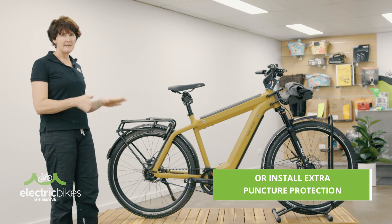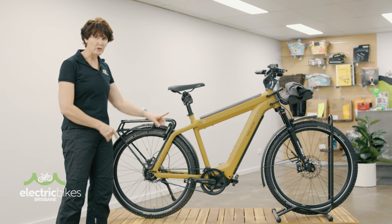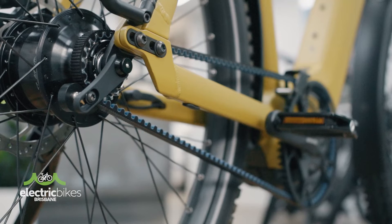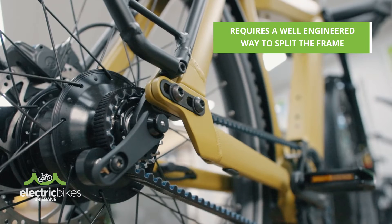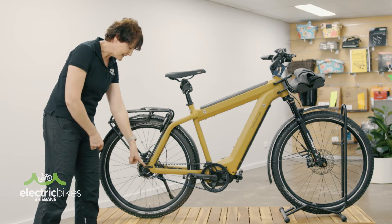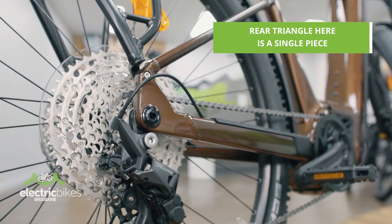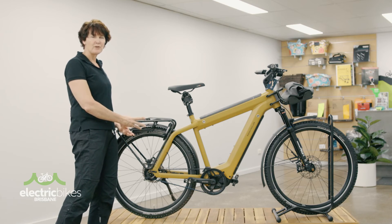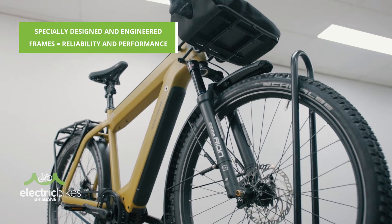What you'll notice — and this is a big difference between a derailleur e-bike and a belt-drive e-bike — is your rear triangles are very different. When you look closely, you'll see on this bike here, the Supercharger, which is running the belt, it's got a split rear triangle. It's actually got sliding dropouts here. So in the case where you do need to change a belt out, you actually have to break or split the frame, and this has been engineered to do that. On a traditional derailleur bike, it's a single piece. But then what you don't see is the engineering and the precision — there's a lot of force going through there. You need a frame that's going to be nice and stiff so you get smooth running of that belt drive.